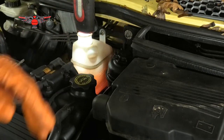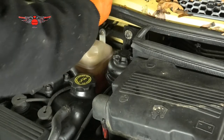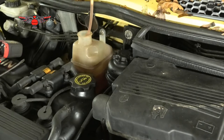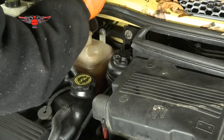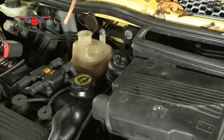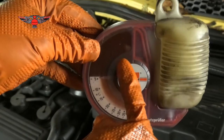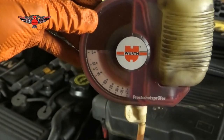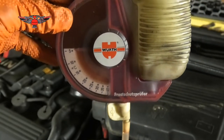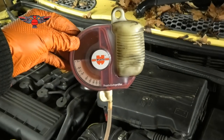In this case, just checking the level, and we're gonna check the percentage of antifreeze with this little gadget here. So I'm just going to suck some of that antifreeze from there, and we're going to see if there is any antifreeze in here. Now I can see that the fluid is really dirty, and also the antifreeze percentage is not reading, it hasn't even moved that much, it's at -5. So to be honest, having looked at this, I think I need to ultimately change the coolant in this car,